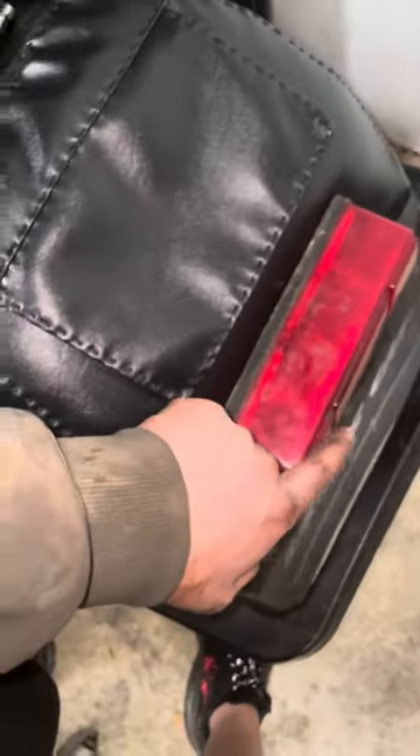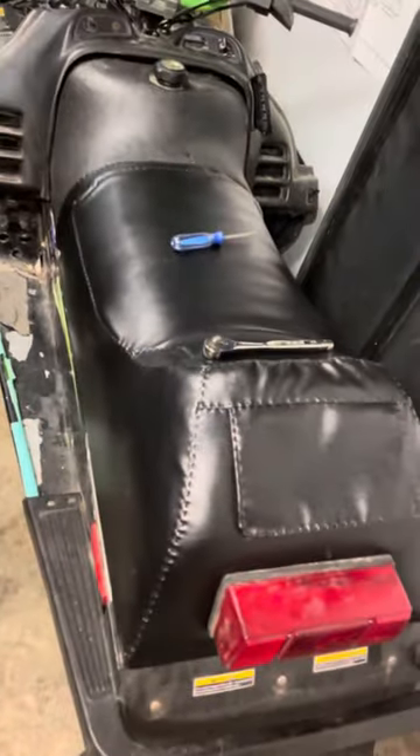Now when you slide it, keep in mind your taillight is still wired in, and that taillight wire runs all the way underneath and plugs in up here. So I would slide it back a little bit, lift it up, and then unplug that prong from underneath, and then you should be good to get your seat off and your tank off.